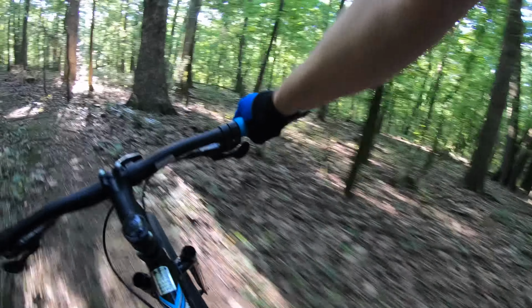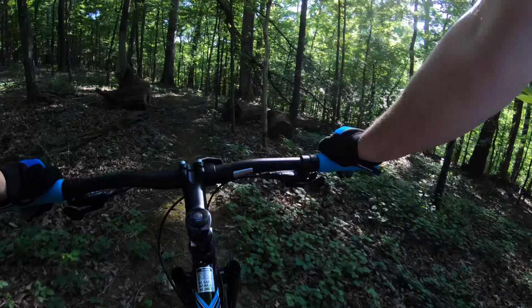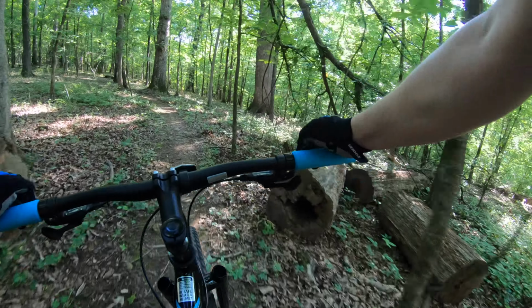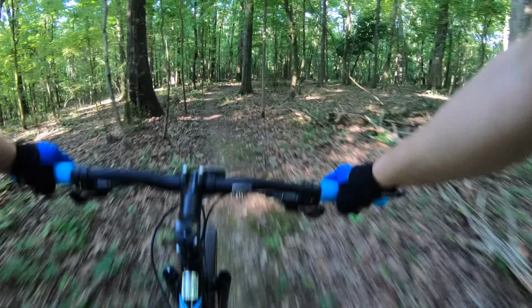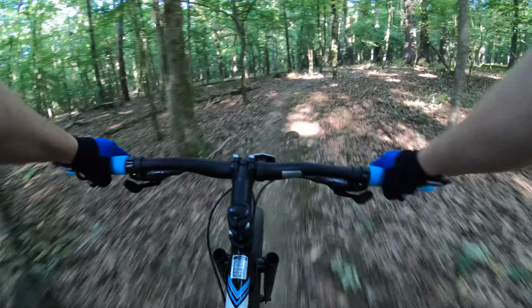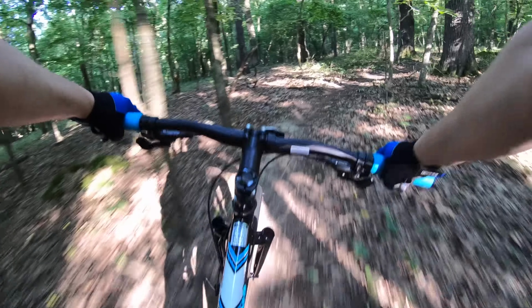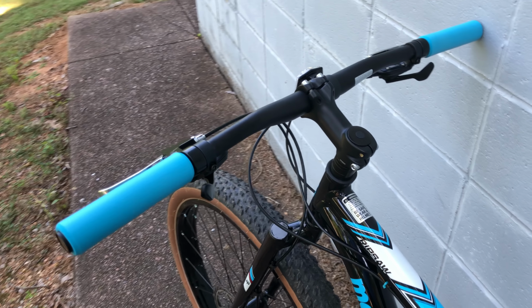I mean, yes, the traction is better, but that was already good, and even though I'm not rattling quite as much, after a little bit of riding, my palms were still starting to hurt. I tried multiple PSI changes, trying to make things even smoother, and I was able to go as low as 15, but right at 15, it started getting a little wonky feeling. Another thing is two solid weeks of e-biking is starting to have effects on my already questionable endurance, but it's worth it. Even with the lowered PSI and the chunky grips, I'm still painfully aware that I'm on the same bike. I mean, the grips did buy a little bit of time, but really not as much as I would have hoped for.